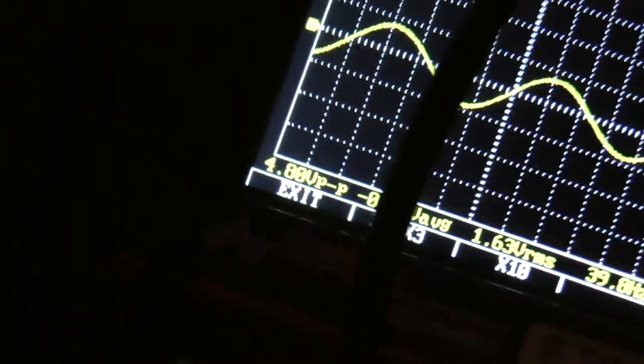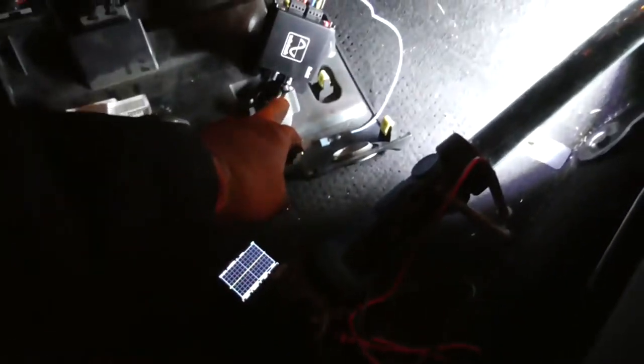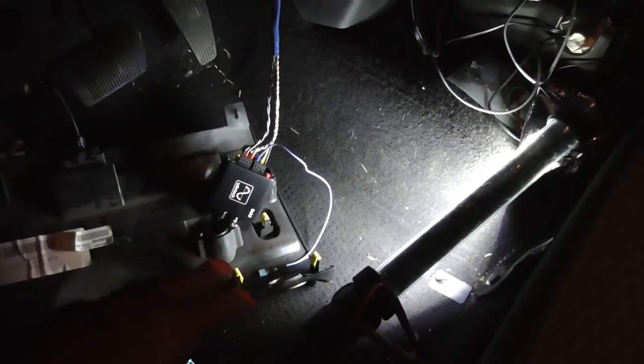There's the waveform — nice and good. The voltage is like 4 or 5. That flat line you saw was clipping — that's not what you want. 34 is probably the most I want to turn it up, and then I'll turn the gain up until it starts clipping, then turn it back down. You want to find where your radio clips with your bass in the center. When I had the bass turned up, it was clipping way down at like 25-26. I got the output set at around 5.5 volts coming out before it clips. Now I'm going to take that, put it up, and mount it. It's starting to rain so I need to get this in the garage.